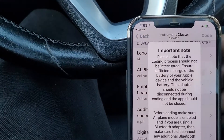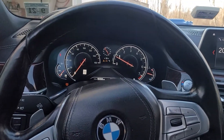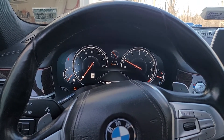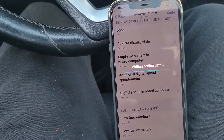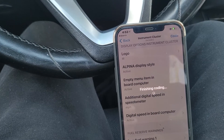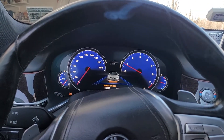We're going to go ahead and code that and see what it looks like when we finish. It's going to change the dash — the digital speedometer and Alpina style will change the layout as well. It writes the code pretty quickly. Sometimes getting into the menus takes a little bit of time due to reading so much of the menu. If you get an error once it restarts, that's normal — after the car restarts the computer, it'll be fine.